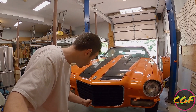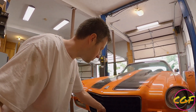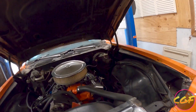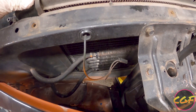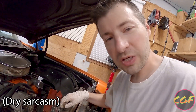So first off, what are we working with here? Reminder of the old days of cars where you could just come by and pull up anybody's hood. Oh boy, it's hard to pull up — and it is heavy. The car has a pretty typical old-school small block 350 in it. I don't know how much horsepower it's pushing, but it's probably not as much as people used to give these things credit for. The first step is pulling the radiator out. We've already pulled the fan shroud out. What we've noticed is there's a transmission cooler here, and then there's also transmission cooler lines hooked up to the radiator — this car has two transmission coolers. It must be a really hot automatic. We've almost got this taken apart; we're gonna pull this out and then move on to disconnecting the motor itself.